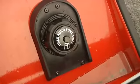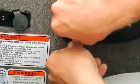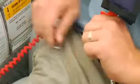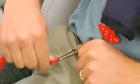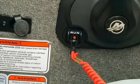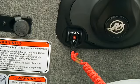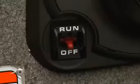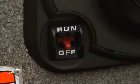You might want to check the vent to make sure it hasn't become home to some small critters. Set the lanyard stop switch to the run position and attach the other end to a belt loop or life jacket. If this switch is not in the proper position, the engine will not start. This is a safety feature designed to immediately stop the engine if you leave your seat for any reason — that's assuming you actually hook the thing to your person. This is an important, possible life-saving device. Do not start the motor without using it.